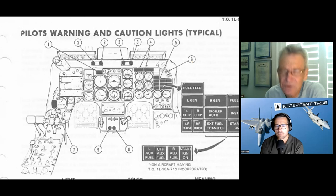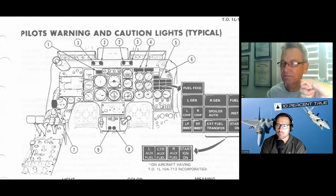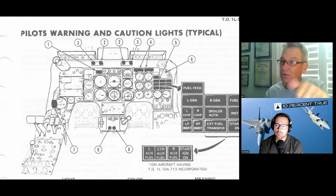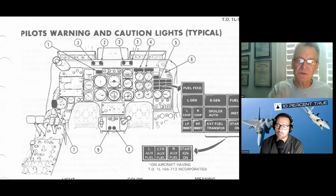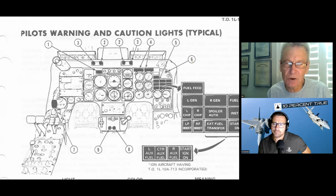The flight controls are all direct linkage. The only hydraulics in the airplane were for nose-wheel steering and gear retraction — an electrically driven pump, on demand only. Normally when taxiing we used differential power — push up one throttle, pull the other back into a little reverse, maybe a tap of the brake on the inside of the turn. Every now and then you'd use nose-wheel steering. Anytime you pressed the nose-wheel steering button, that green light should come on. The flaps are hydraulic too, so if the flaps were moving that light would come on. The amber one means pressure was low while the pump was running.